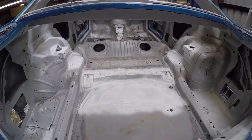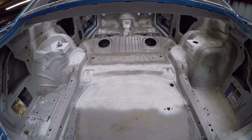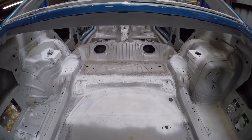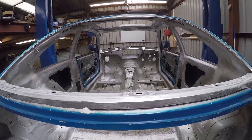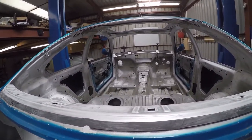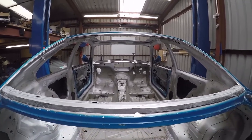The interior has been fully stripped out — all the sound deadening, all the wiring, the entire loom has been removed. There's a roll cage going in, so all the feet have been welded and that's ready to go back in once it's all been painted. All the glass has been removed. I'm going to use Perspex or Lexan for the rear quarter windows and the rear glass. I need to replace the front windscreen — I smashed that installing the roll cage, though in hindsight it was a lot easier to get the cage in and out without it, so I should have smashed it from the very beginning.